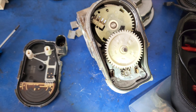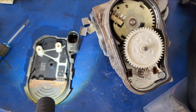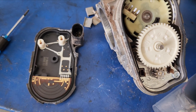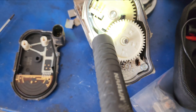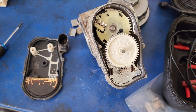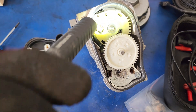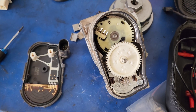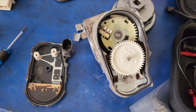We are apart and it does look like we have our track marks, just like the repair solution says. We've got a bit of dirt down the back there. To prove it, like the repair solution says, we'll bend these tabs a little bit more forward, try and clean this up a bit, put it back together, and check the next cold start.